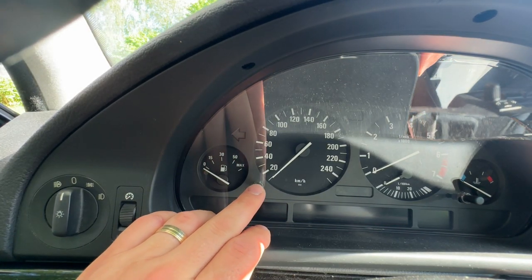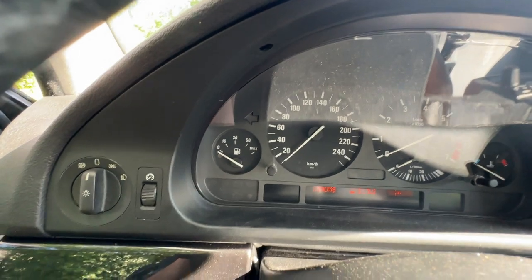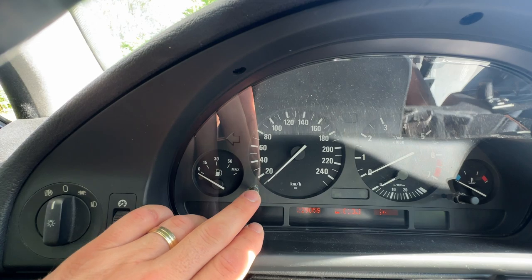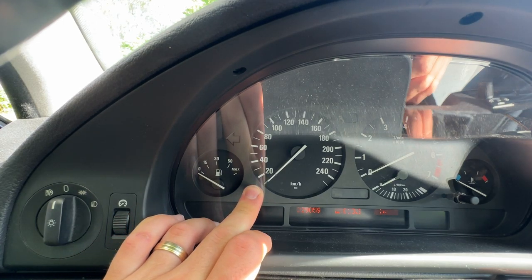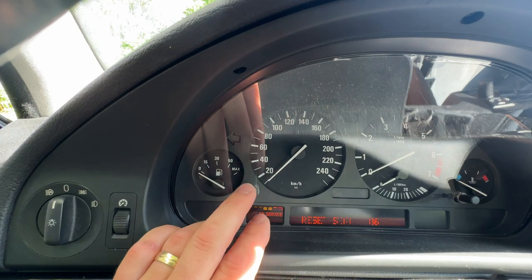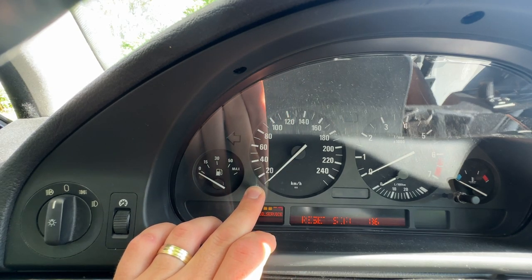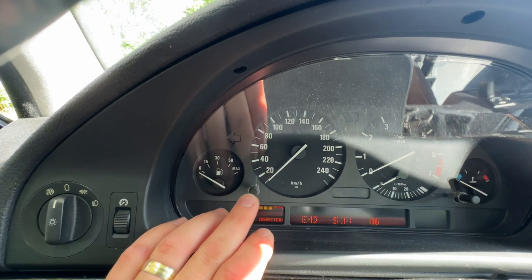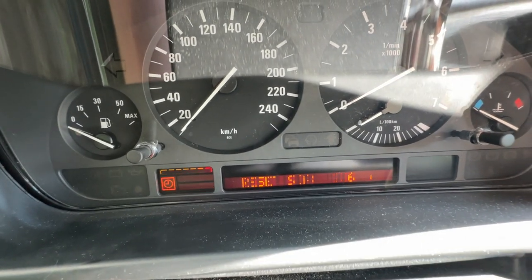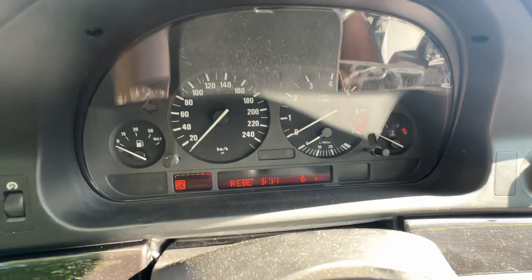You have to be faster. So hold the left button pressed, key in position one — 'Reset SIA' again — long press until 'SIA Reset' will blink, and then a short press. And you can see my oil inspection is now reset.